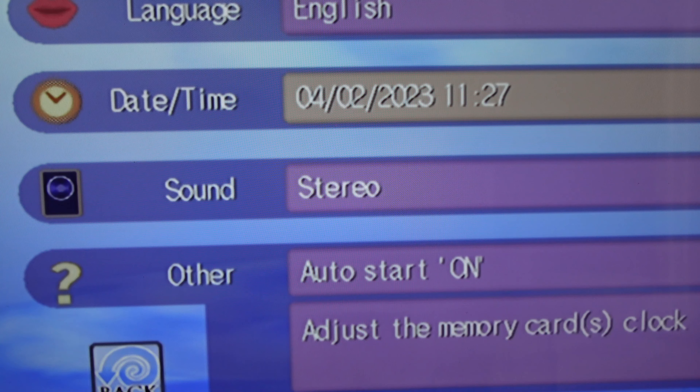So this is the screen you'll be seeing every time you turn the console on when the original battery dies. Now with the modification and the new battery this won't happen — it'll only happen again once the replacement battery goes dead, and then you just have to swap it out. The date and time has been set, I've restarted the console and you can see it loads straight into the main menu, and when you go into settings you can see the date and time is now saved. Thank you for watching, I hope you enjoyed it — please like and subscribe and I'll see you on the next one.